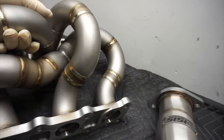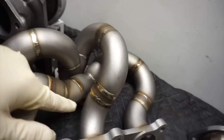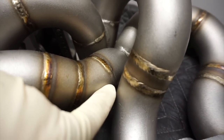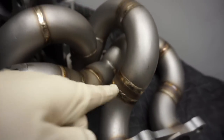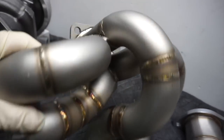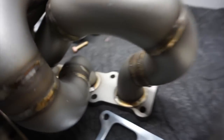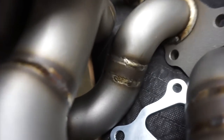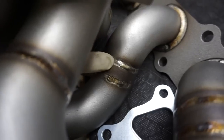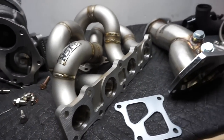But I just realized they're kind of fake welds around the outside — just to make it look pretty. If you look closely, the actual weld finishes underneath the coating, and they just weld around it to make it look nicer. You can see this weld kind of stops here — that's the real weld under the coating. But overall, pretty well-made kit; I'll find out for sure once I install it.